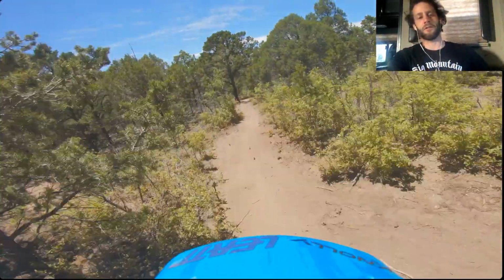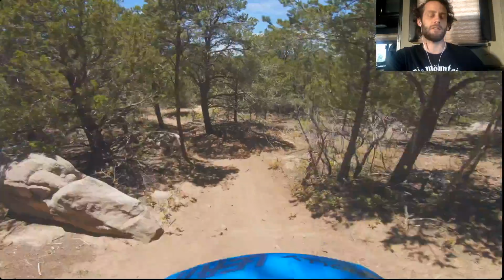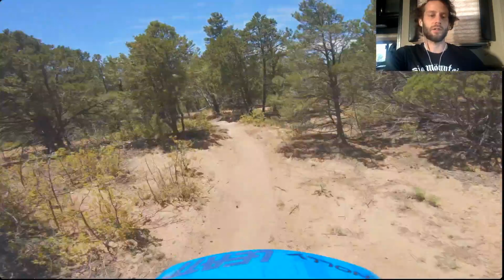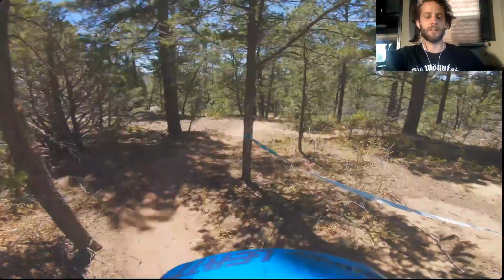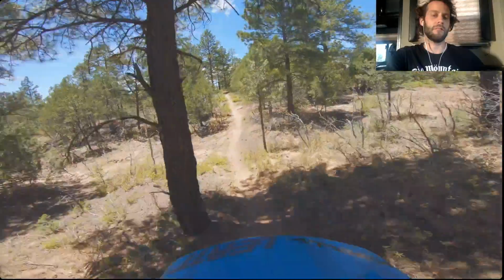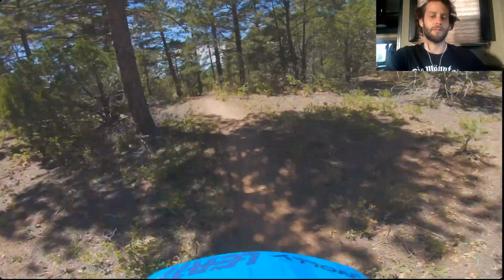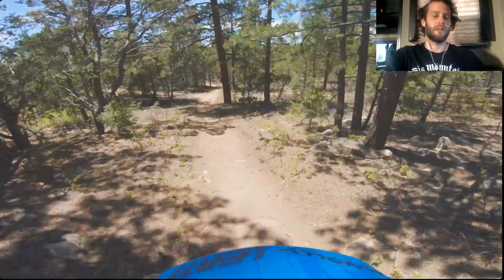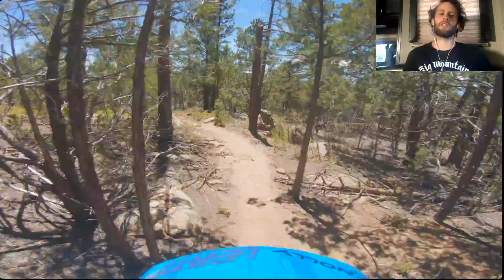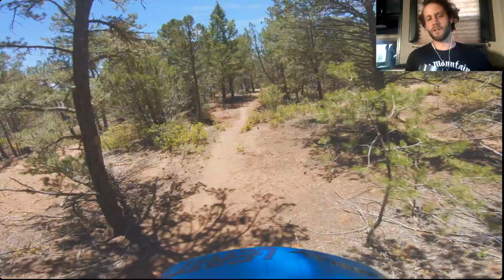But yeah, my rebound was too fast. It was just slamming me backwards into all the rocks and stuff like that. It's super tiring and did not hold traction well. When I would turn, it would want to skip. So it's basically fighting the front of the bike the entire time to stay down and not throw me around. Which also made my legs tired, because when you're getting thrown backwards, you lean back and squat more instead of going into the right position. So yeah, legs were a little tired too.